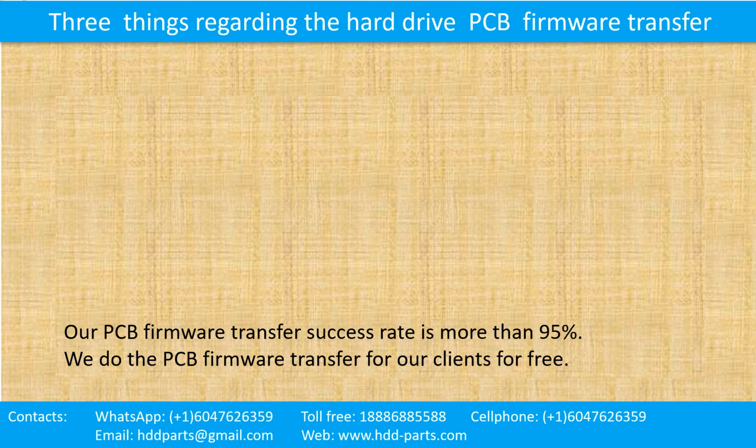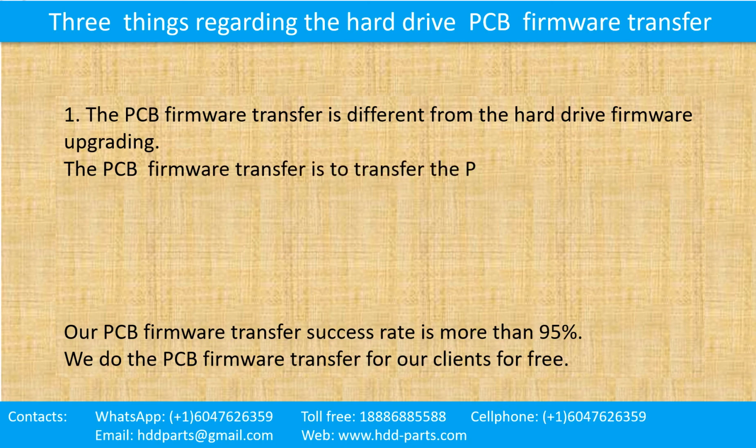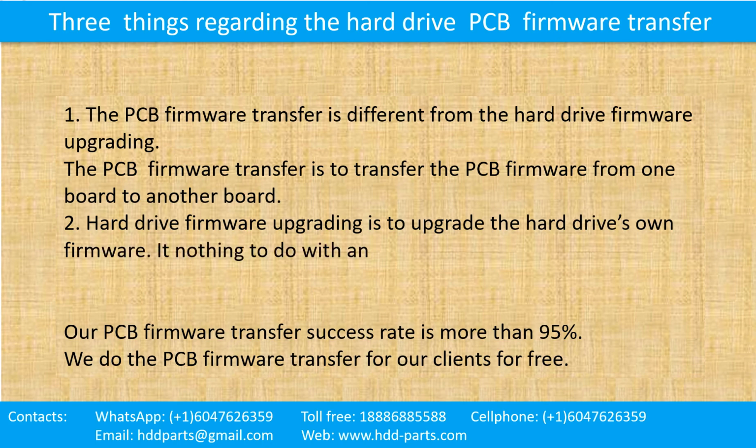Three things regarding the hard drive printed circuit board firmware transfer. 1. The printed circuit board firmware transfer is different from the hard drive firmware upgrading. The printed circuit board firmware transfer is to transfer the printed circuit board firmware from one board to another board. Hard drive firmware upgrading is to upgrade the hard drive's own firmware. It has nothing to do with another hard drive or another printed circuit board.